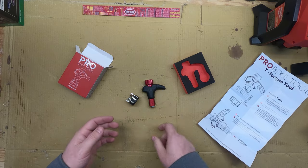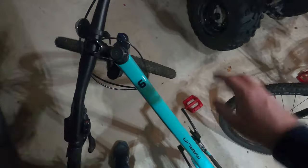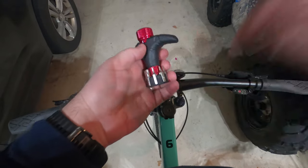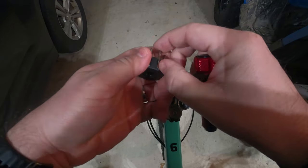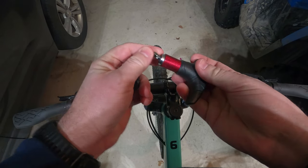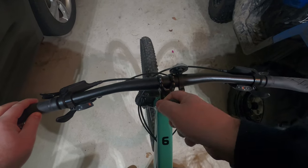I've been playing with the tool off camera. The red and black goes well with the color scheme on my bike. We're going to use my wife's bike for this test because it's a bit easier to see. I'll also link in the description where you can purchase this on Amazon. I pop off the bit, slide it up — it comes out easier that way — then push it back in and it locks. Setting it to four Newton meters, I put the bit in the top bolt. It should just pop — and yes, it pops. Perfect.